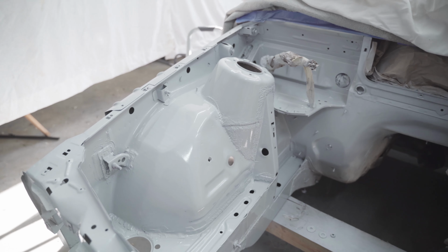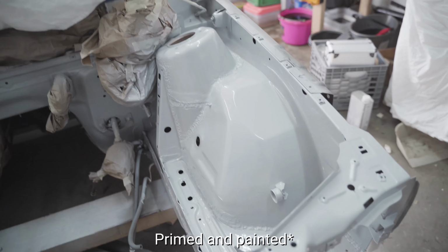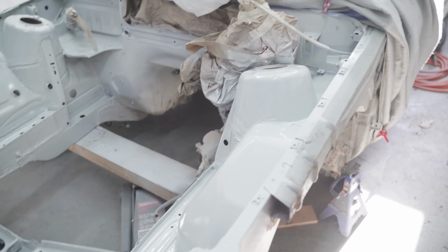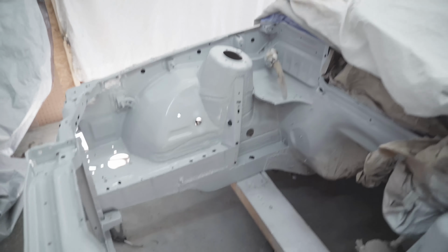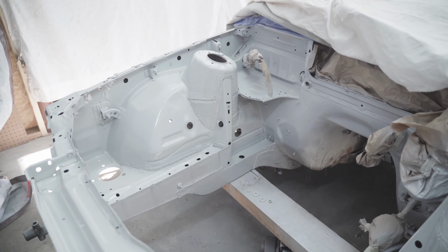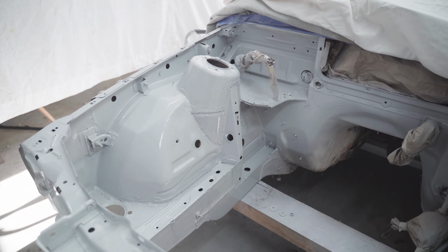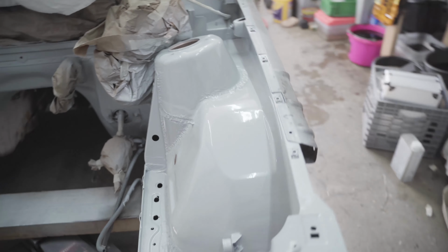So I finished painting the whole thing. I didn't record any of it, mostly because I didn't want to get any paint on my camera. I used an actual paint gun and it tends to get overspray everywhere. So what I did was I put up sheets and a tarp in my garage and blocked everything off, and then turned up the heat and then sprayed it and gave it a quick wet sand, and then did a couple final coats the next day.